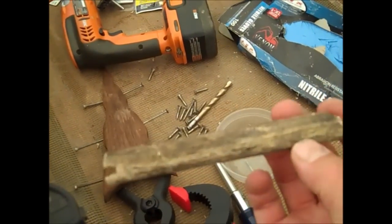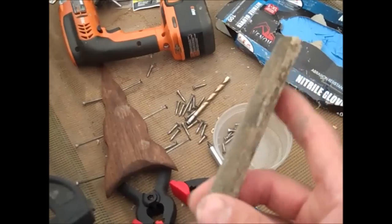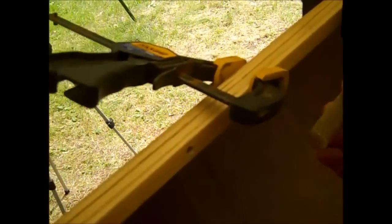Now what I did was just take an old piece of the old gunnel, and with each of the screw holes on each end, I made a mark, following this from screw to screw, and just put a mark and a mark and kept going down and I marked off the whole pattern. You do not want to use the old holes, so you want to be off a 1/2 inch or a 1/4 inch, or you know, a whole inch, whatever you want, but just make sure you're not going into the same pattern of the old holes. You want to use new holes for strength.